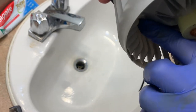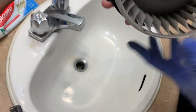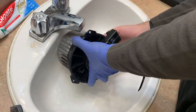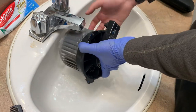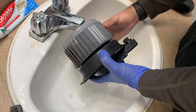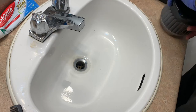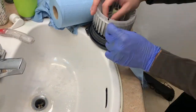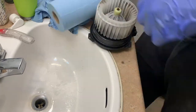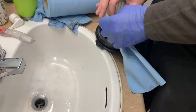Here's a quick look at how dirty the blower motor was. Now we're going to wash it under some hot water to try and get any loose dust off of it. Remember while washing the blower motor not to let water get down that black ventilation tube, as it will lead water directly to the motor and it's not designed to be exposed to the elements. Now I'm going to take a piece of damp paper towel and clean between every single fan blade. Note that it would probably have been easier with a paint brush to brush the dust away.